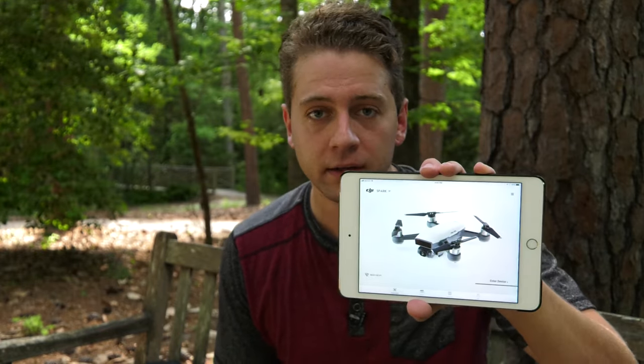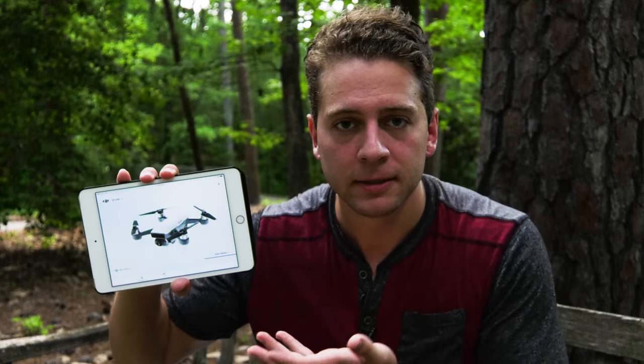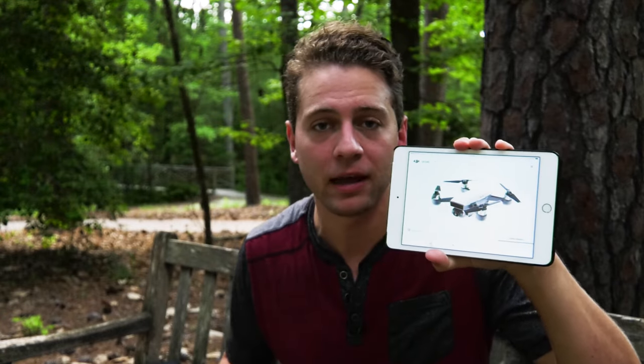I'm using an iPad Mini 4 here, and a lot of people use just a smartphone. This is an iPad Mini cellular model, which means I could apply a data plan to it. However, I was using it strictly with a hotspot from my cell phone to the iPad for a while. Why would you want to hotspot your cell phone to your iPad when using the Spark? Most notably, no-fly zones. If I'm near an airport and I have full authorization to fly there, the DJI Go app will not allow me to fly unless I'm connected to some sort of cellular internet, where I can accept terms and conditions and put my information in to unlock that area. If you're utilizing the iPad's Wi-Fi to connect to the controller, you cannot also use it to connect to a cellular hotspot. So you really either have to use a cable or get a cellular plan for your iPad. If you have a Wi-Fi only option, you're out of luck in that respect — you've got to use the cable.